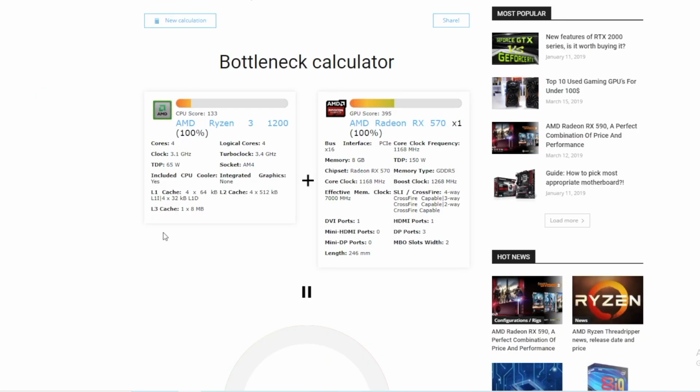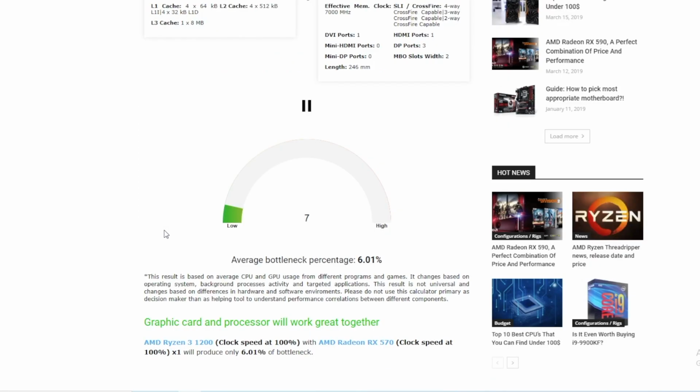Now earlier I mentioned bottlenecking. This is when your CPU is either too strong or too weak for your GPU and vice versa, resulting in your CPU lowering its performance or your GPU lowering its performance to match each other. In this website that I'll link down in the description, you can put in your CPU or the GPU that you plan on using, and then it'll give you the average bottleneck percentage. So for this CPU and GPU combination, it'll give me about 6%. This is great because you want as low as possible.